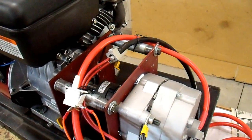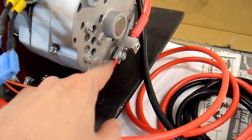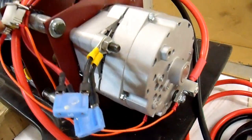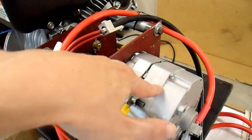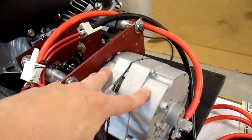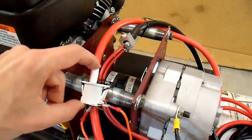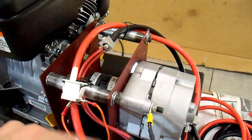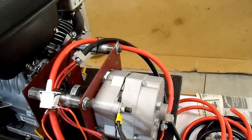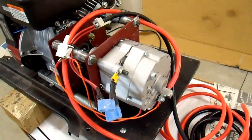If you use a toggle switch and the engine quits, then it starts draining your battery. You can connect a resistor or something in there, but I'm not doing that — this is just full field current. Don't do that if you use a toggle switch, because if it stays closed the coil inside will burn itself up without some sort of limiting device, like a lamp or a resistor. This is the easiest way to do it. You can't do it this way in an automotive system, because you would have a run-on condition if you connect it directly to your ignition switch — the power feeds out of the alternator back into your ignition and you can't shut your car off. But I can safely do it this way in this setup.